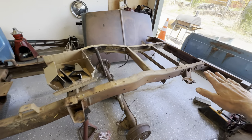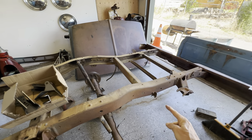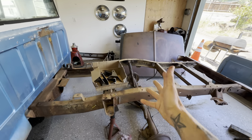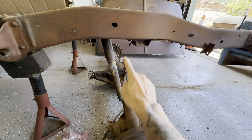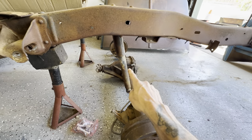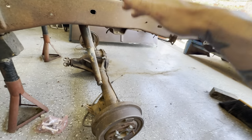Z the entire frame, and then I'd have to Z it back here. But I gotta take 8 inches out back here anyway to realign the bumper output. But then the bed floor will all be raised up — probably gonna be 3 inches — just to get the axle. So when the tires are on it, that part of the frame can sit on the ground and the axle will just barely be touching.